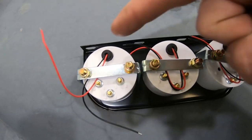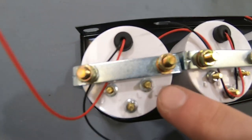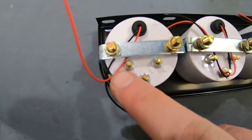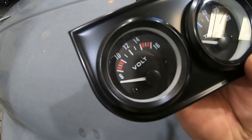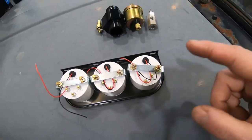So the wiring of this is pretty simple. We've got three bulbs for your backlighting, and then each of these you can see you've got a positive, a negative, and a signal wire. This one here doesn't have a signal wire because that is the volt gauge, so it just needs a positive and negative to read the voltage. So it should be fairly simple. I'm going to get the bonnet open, get all the sensors wired in, and run the wires through into the cab. Then we can mount the gauges - should be a fairly straightforward fit.